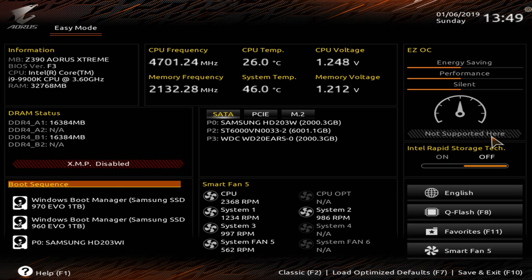The second thing I'd like to mention is that on my specific board the i9-9900K was actually already running at 4.7 GHz across all cores without me fiddling in the BIOS whatsoever. So it was already running above the 95W TDP rating, and therefore going from 4.7 GHz to 5 GHz won't yield significant increases in gaming performance. If you're really only interested in gaming, enabling XMP is basically all you need to do to get the most out of your chip.